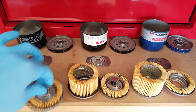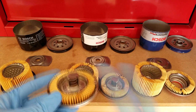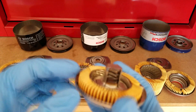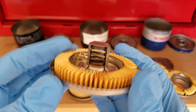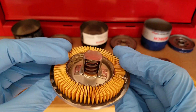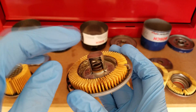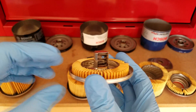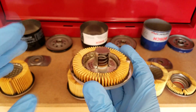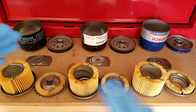The bypass valves have pretty much the same design across all three tiers — a captured spring and disc-shaped valve on the bottom. These valves look like they're made from compressed fiberboard; they look like cardboard, though they're quite stiff. I have seen other manufacturers with a similar overall design that make these seals out of plastic, or my favorite, which is rubber. It'd be nice to see that, but I'm sure they all work well enough as is.